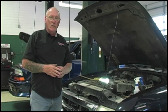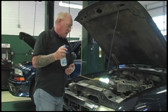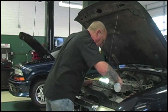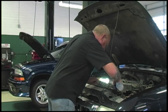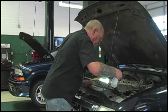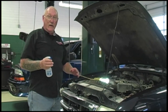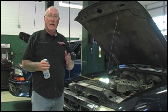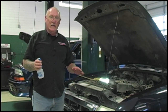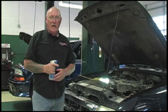You can also check it with a bottle of water. Just spray a little water on the rear side of the belt with the engine running and listen to see what happens to the noise. Same principle — if the noise gets worse or continues about the same, that's a tension-related issue, a squeal. If the noise goes away and slowly comes back as the water evaporates and dries, that's a chirp — something's out of alignment.